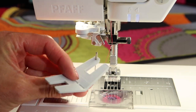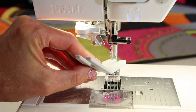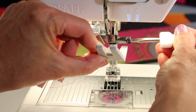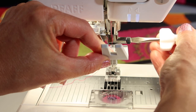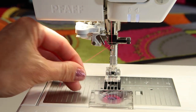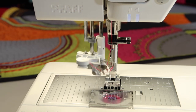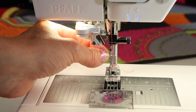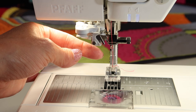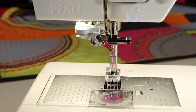Putting your needle back in, I have it in the little holder, flat side to the back. I'm going to take the point of it down the foot first and lift straight up. You do need to make sure you get it as high as possible before tightening it. I'm going to just tighten it a little bit with the screwdriver — not over-tighten it. If you use your needle threader and it goes through the hole of the needle, you know your needle is perfectly aligned. If it did not go through, the needle may not be at the highest position. Adjust it, make sure it gets all the way up, tighten it gently, and you will be ready to go.